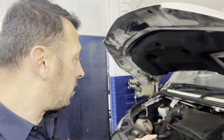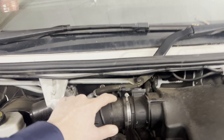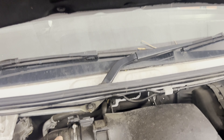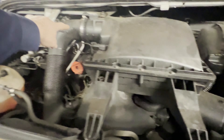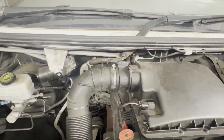What we're going to do first is a simple thing: we're going to strip the intake and if we hear a lot of noise from there, that's going to be an indication the noise is coming from the camshafts — from the top end. This is a good first step. We'll strip that and then start the engine again.